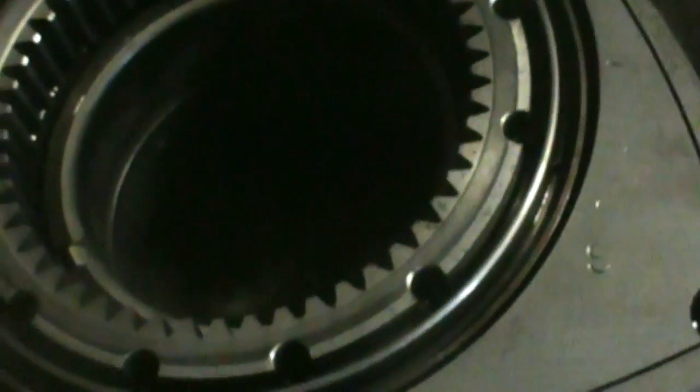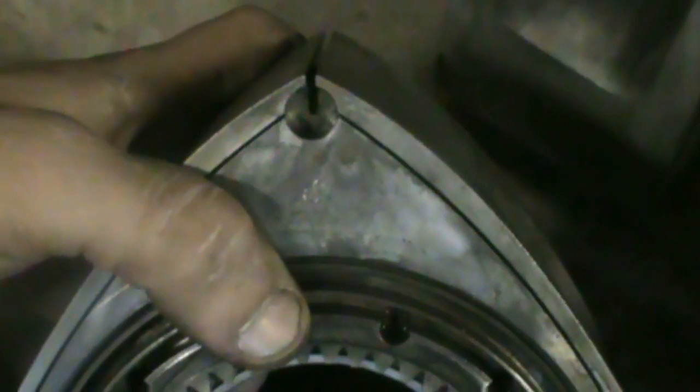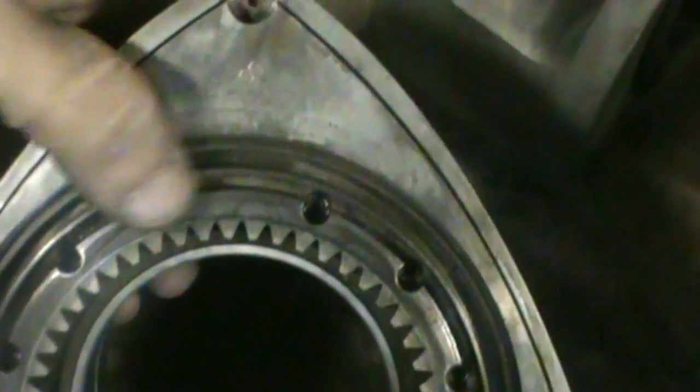It's like a little flat wire wheel thing, and then just go around the grooves for the oil control ring. So I'm just about to clean those up, then they can go for a quick rinse off in the parts cleaner, and I can start assembling those. Alright, so I went around those corner seal grooves there, so they're nice and clean, and just in where the oil control rings sit, they're cleaned out. So I'll just soak those things, get working on some other stuff.